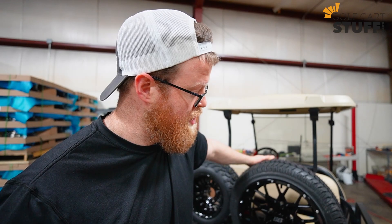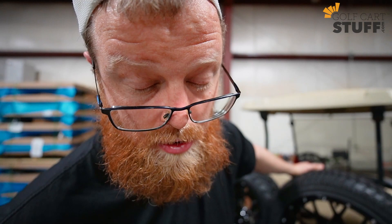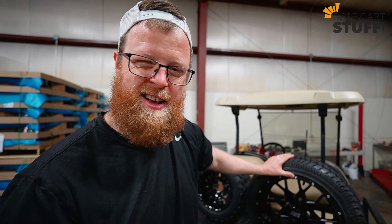On car tires, speed rating makes a big difference. On golf cart tires, it's not as important. You may see a golf cart tire with a speed rating of 80-something miles an hour — you definitely don't want to take your golf cart that fast, trust me. These are just rules of thumb for safety. For golf cart tires, don't go 75 mph and don't load as much weight as they're rated for. Lastly, you may see a DOT number, which indicates where the tire was manufactured, the year of manufacture, and so on — not really important to know for golf cart or car tires.